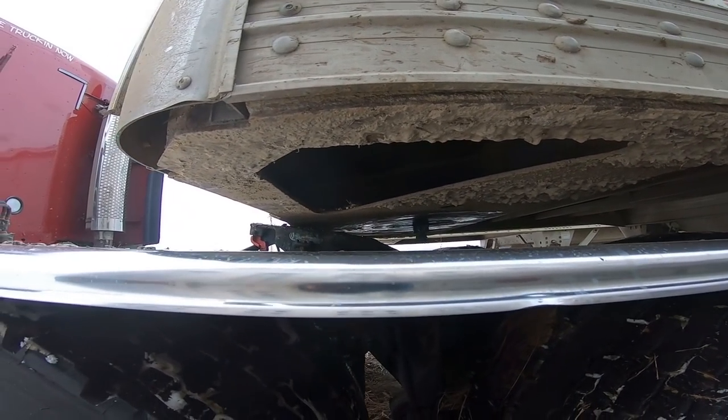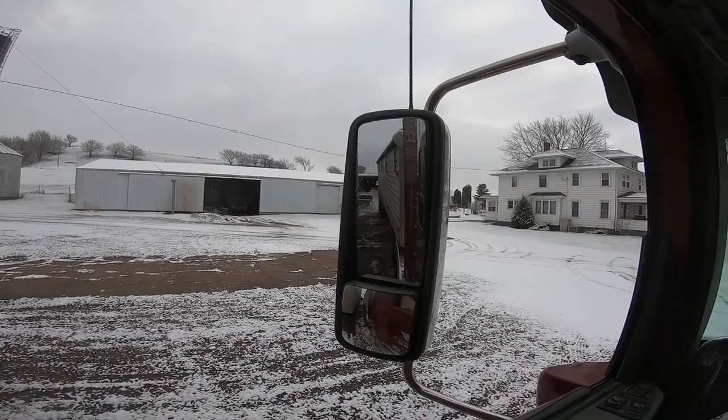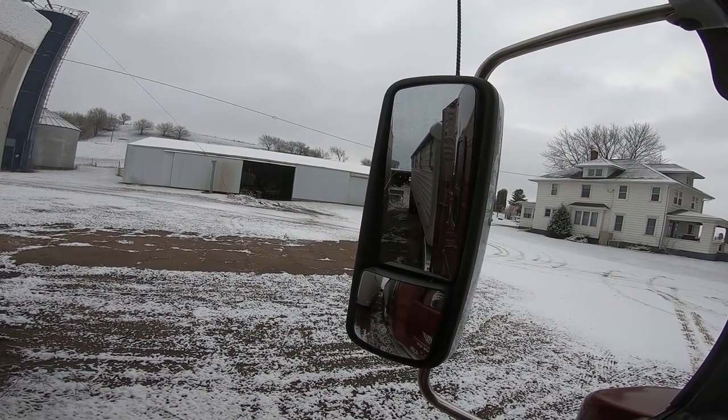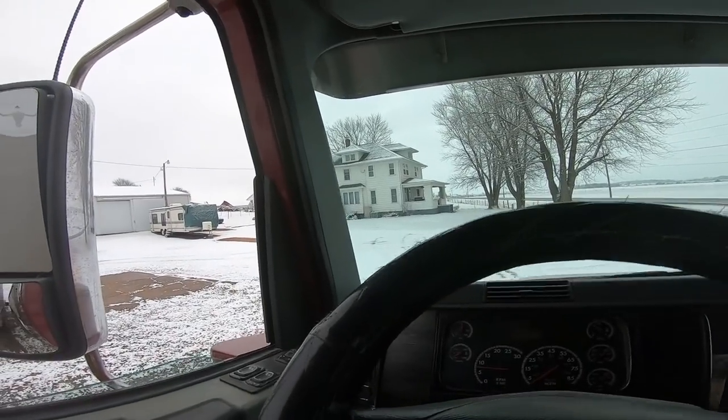I'll back up another six inches, raise up, and back into the kingpin so it locks in. You should hear it latch — there we go. Now before I even hook up the trailer and lower the jacks, I'm going to pull ahead a little bit just to make sure I'm latched. You want to put some force on it because if you don't, you don't know if your kingpin is fully locked. I've known people to pull away without hooking up and their trailer just goes boom. Always pull ahead and check — it's just good practice.